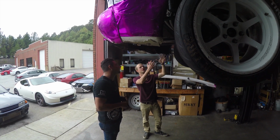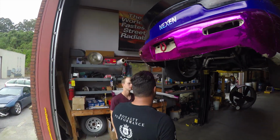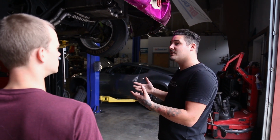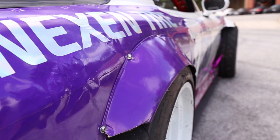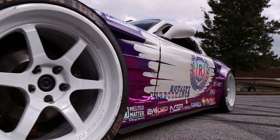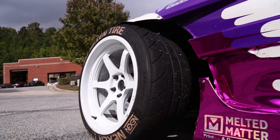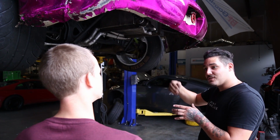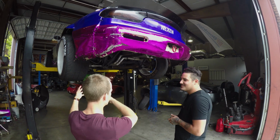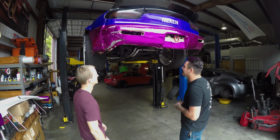How do you get airflow? Are there any specific things or strategies you do to get airflow back there? Yeah, that's actually the biggest hurdle when you put the radiator in the back. You have to do a Lexan rear glass and find some way to cut it to duct air into it. What's lucky about drift cars is we're not going straight, we're going sideways, so the air has more chance to hit a ducting scoop that you fabricate to get the air to go into the back. Also, the natural aerodynamics of air going over a vehicle wants to follow the rear windshield down, so the air is directed right into the radiator. Yeah, that's not something I'd ever thought about, because a traditional aerodynamic setup, like on a supercar, is going to be totally different than a car that's built to go sideways. Exactly.